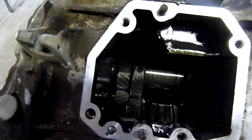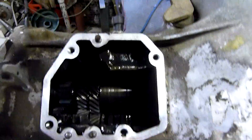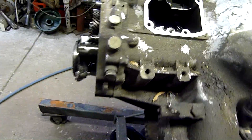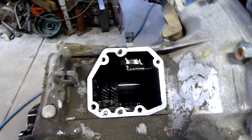It looks like with the selector shaft in the centre position like that, that's neutral - that's where it is at the moment. So if I turn the input shaft, everything spins but it doesn't drive the differential properly. The oil itself is actually dragging it around, but if I hold the output of the differential and turn the input shaft at the same time, I can hold the differential stationary by hand. So centre position is neutral.